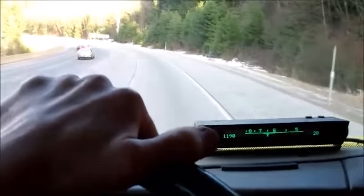I saw 47, 46, 45, which is higher than normally I see, which is a good thing. Okay, you want to know my first impressions about this product? It's awesome. I started climbing that big hill right after the truck stop in North Bend, right? And at first I was afraid to use the boost regulator. So I was basically using just one harness, which is hooked up to the fuel sensor. And even then I saw my boost increase to 47 when working under heavy load.